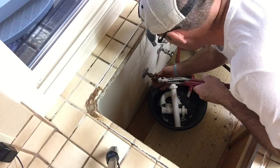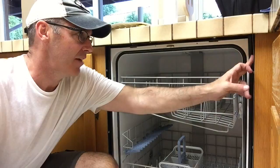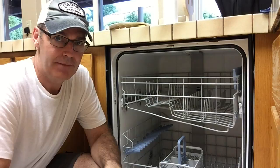With a more recent dishwasher, you only have two screws up here — one here, one here. This is a much older machine, and they've got it screwed into all the sides, which obviously makes it more stable, but not these days. So I'm going to unscrew these and then we'll be able to pull it out — after, of course, we've removed all the plumbing from underneath, typically the sink.